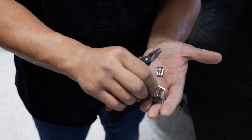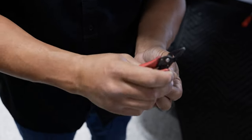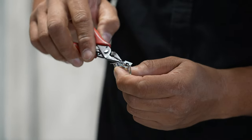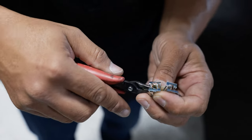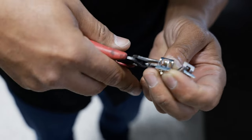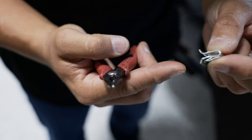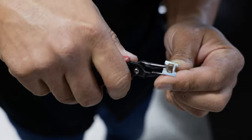Save all these clips because we're going to have to reinstall these on our panel. If you look here, this is how your clip should look — you can see those teeth in there aiming down. The ones that look like the teeth are all bent out of shape — that's what most of your clips are going to look like after removal. This is where you grab your pliers and bend those teeth back down into the right direction so you can get those back on that panel. Once you get all the teeth looking like the good clip, you'll be able to slide those back over the protruding plastic pieces on that panel.